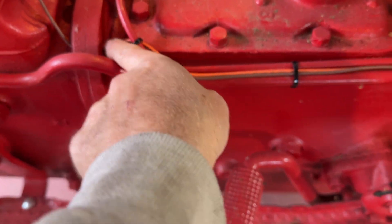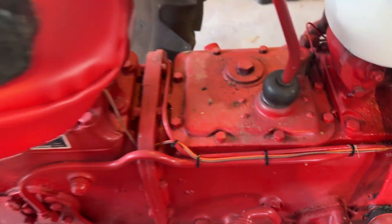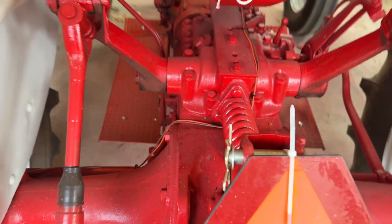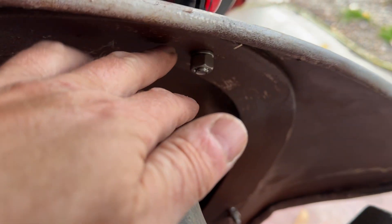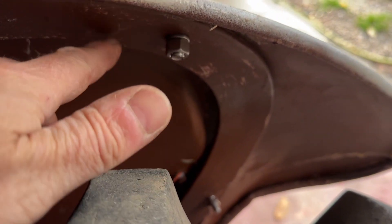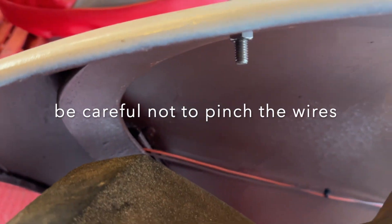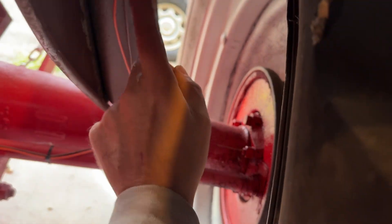In the transmission case there is a hole — that's where the wire goes through. I ran it up under the seat, through there, down, hooked it to the brake rod, and up the other side. These fenders are a two-piece design: the shell itself and the bracket that holds it on. I disconnected the fender, ran the wires in behind so they came up, and tie-wrapped everything together from there to the fender bracket, then right up the side.